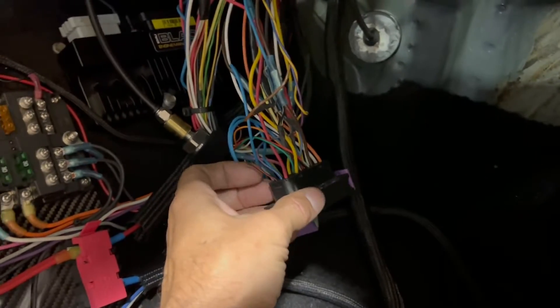I need to make a few wiring changes. I need a 5-volt source — the VR sensor doesn't need one but the hall sensors do. You have 5 volts in, ground, and then your output, which is a digital signal — either five volts or zero volts. That's why hall sensors are a lot better than VR sensors: it's either on or off, not a sine wave that can be affected by interference.